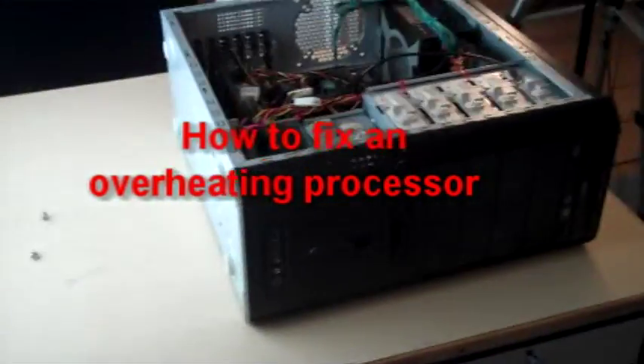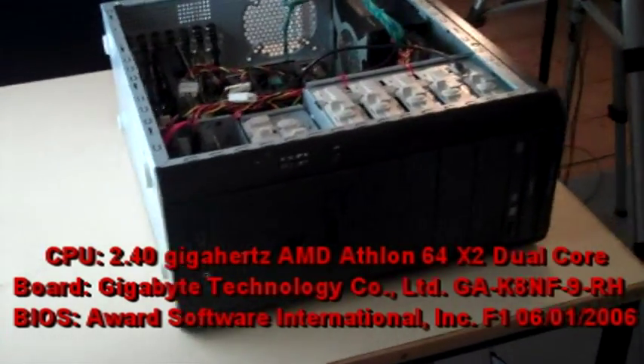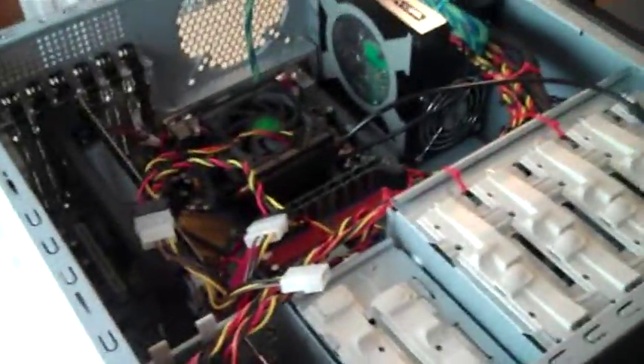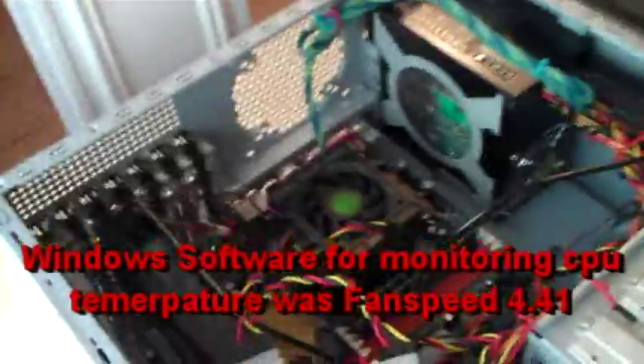Here's the beast - this is my Athlon 2 gigahertz PC with 2 gig RAM, and it was overheating when I was rendering. I put in a little piece of software to monitor the temperature and it was going above 70 and then crashing, so I determined overheating was the problem.